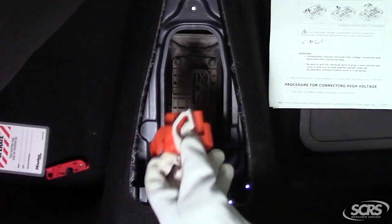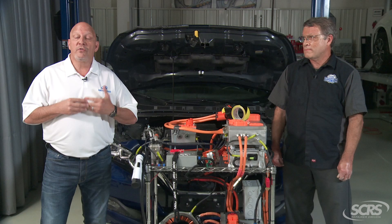I happened to be there and they asked if I had any idea what might be causing it. I reached out to Jake Rodenroth, and Jake said to look in the back of the vehicle for a plug that might have come unplugged. During the masking process in the interior, a little connector had gotten bumped and disconnected. Ladies and gentlemen, as we start to see the advancement of EVs in our industry, there are a lot of things we're going to have to start thinking about.